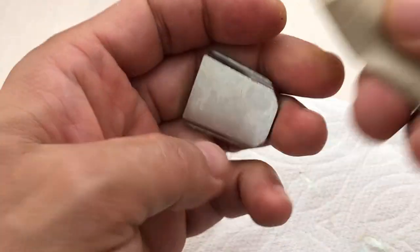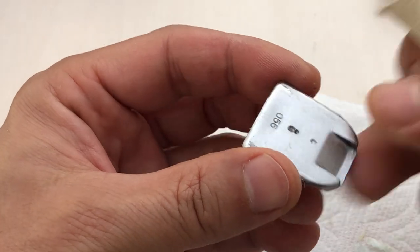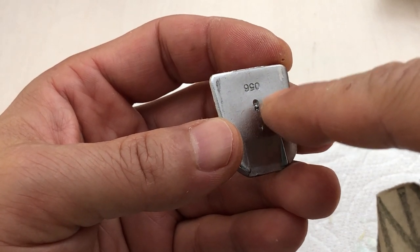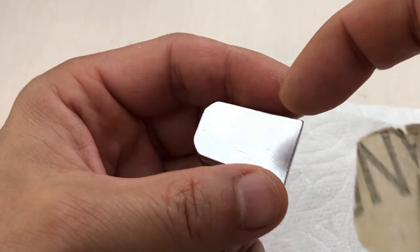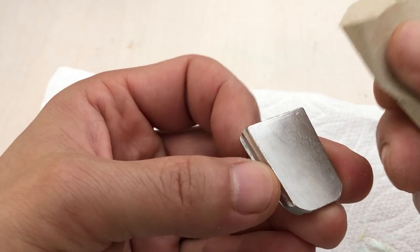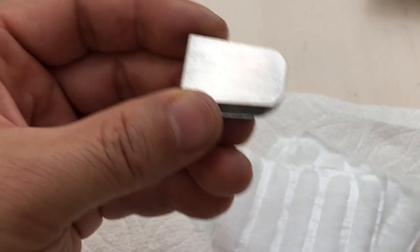Take the sandpaper and don't scuff up the edge — that's where the rearview mirror is going to slide down. Just scuff the button surface. Make sure you're scuffing the right side. You can see the little hole marks where the torque screw was tightening in — that side is the side that glues to the windshield. Don't scuff the other side; you just want the top surface.